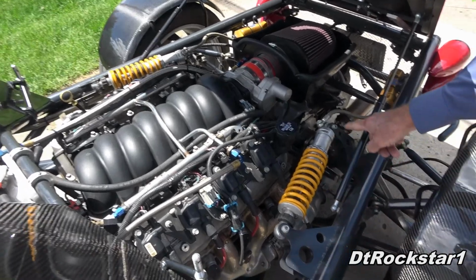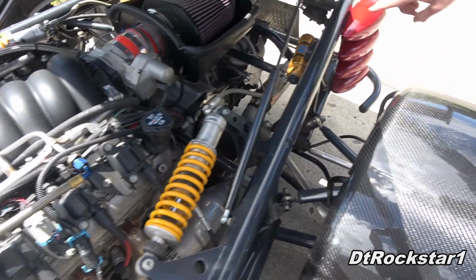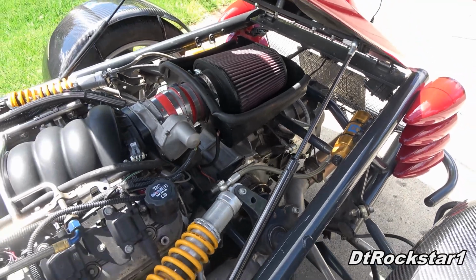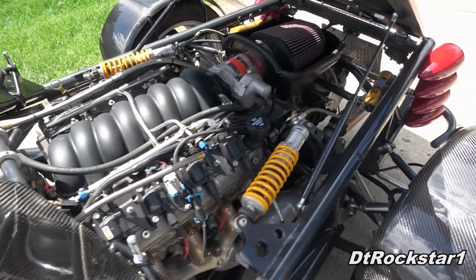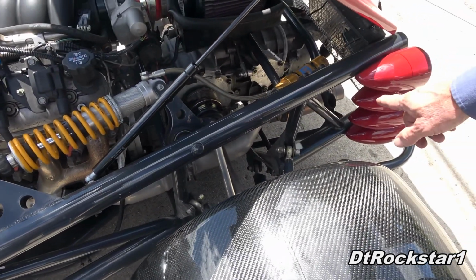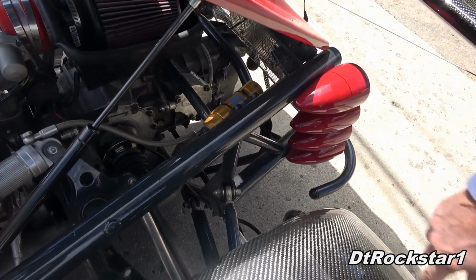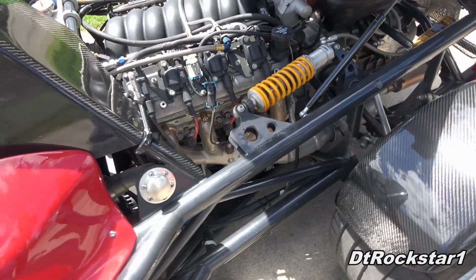You can see the inboard shock spring arrangement for the suspension, and you can see the cable shift mechanism and the Porsche G50 transaxle mated to this LS2 engine. It works out, and you can also see how strong this chassis is. I mean, lots of reinforcement rails. One thing that impresses me is even the back end, which you think would be open and flexible on top. There's 3 separate crossbars reinforcing the chassis going all the way across. Actually, I guess the top, there's actually 4. So it is very sturdy, very strong.